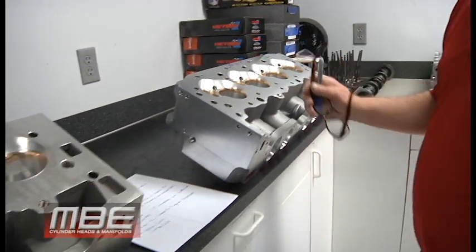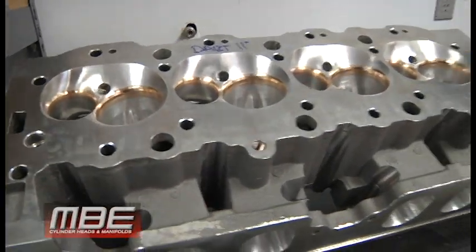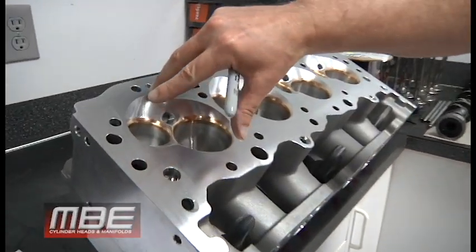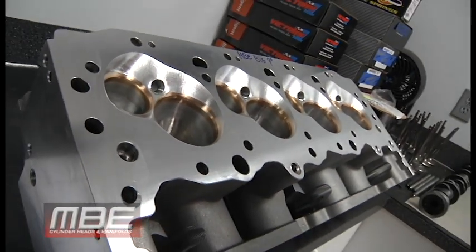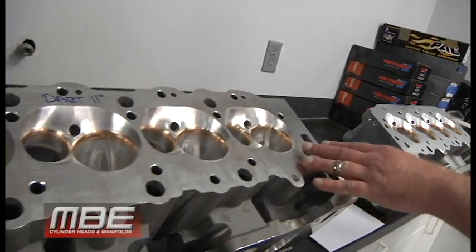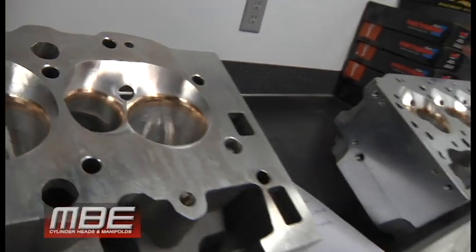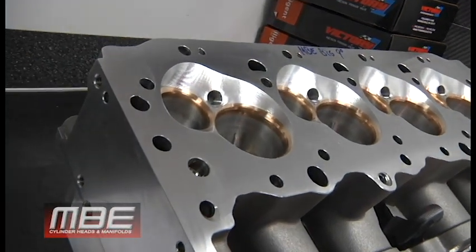Okay, so then you go to the exhaust. Over 370 CFM versus 345 CFM. If you look at the valve positioning, look at how much the MBE BIG-9 is rotated, more like a DRCE3 is how that's rotated. If you go over to here, you see that it hasn't been rotated, because this is how we did things 20 years ago. Things have evolved. When you rotate that, the exhaust gets better. The pushrod clearance gets better because everything gets narrower. It just makes everything better.